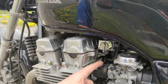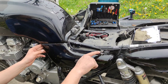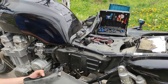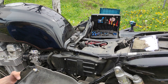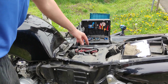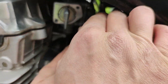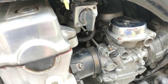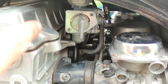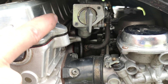To get better access to the oil pipe bolts, we're gonna take down the gas tank. I already took down the seat. This panel is supposed to have a screw here but mine doesn't — I'll put one there later. It's fixed at two points and is pressed into the gas tank, so after taking it and the one from the other side down, we can release this bolt. There are two rubber hoses here that we'll take down using pliers.